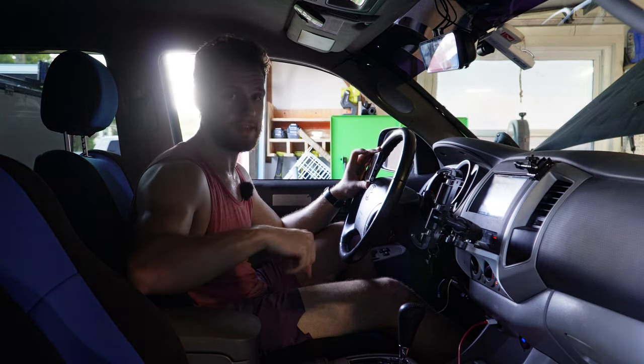Make a mess again. And we want this to be a trickle. Look at that perfect red. That's brand new fluid. Like I said, we're gonna leave this till it's trickled. And you have to leave the engine running. You cannot do this when it's stopped. It will flood.